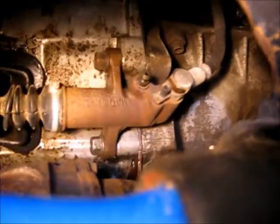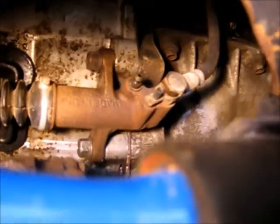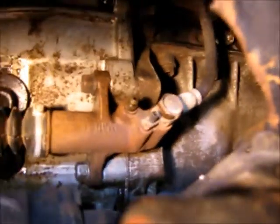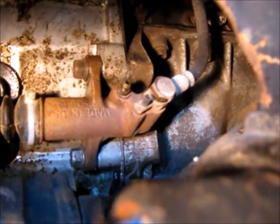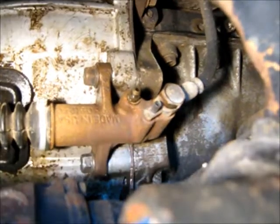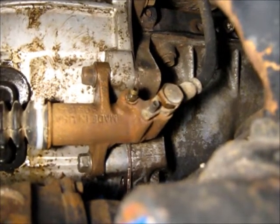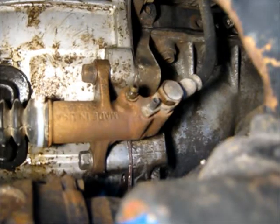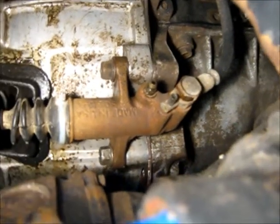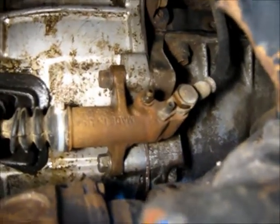Matthew is still up in the cab there, and he's been doing all the pedal work for me. And here is our slave cylinder. Again, you're going to need your 8 mil. So what we've done is the same call and response method — push, holding, release — that we just discussed. I'm attaching my tube onto the bleeder nipple. We've done about 12 pumps down here. I filled up the little reservoir for the clutch twice and cycled that through.